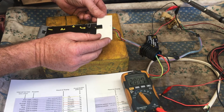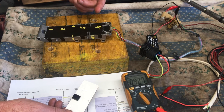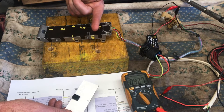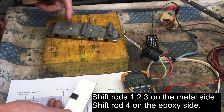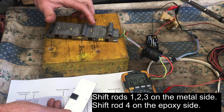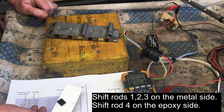Of interest with the sensor itself: because the magnet runs on this side of sensor 4 but on this side of sensor 3, you only get the correct response when you put the magnet on the appropriate side. It won't work if you put it on the other side.